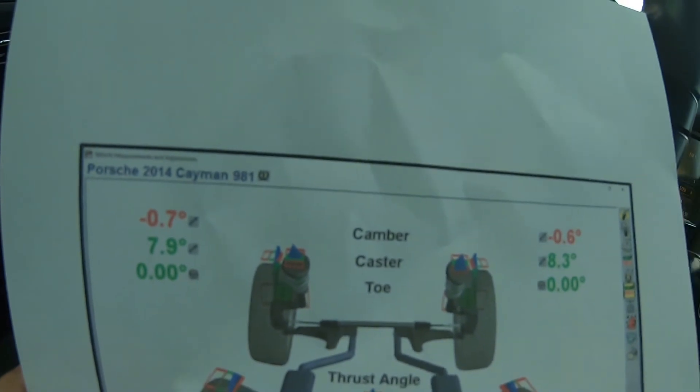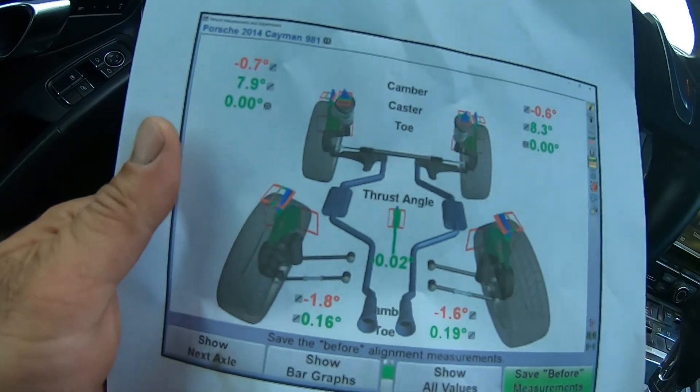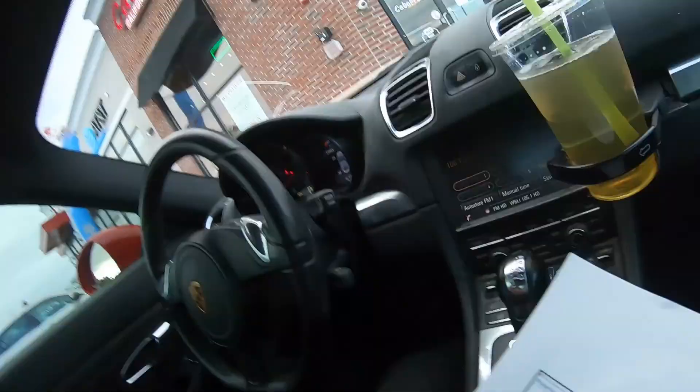I finished with the alignment. I gave it a little bit of extra camber in the front. Toe is good in the back and we also gave it a little bit of extra camber there. I stuck with toe on stock settings. I might take this car to a track because I've never felt this car on a track and want to get an idea for it. I gave it a slightly more aggressive alignment — not a full track setup, but something more in the intermediate. It won't make the tires wear too much more on the inside. Now I'm going to go on a test drive with this thing — maybe a little bit more of a spirited drive, just to feel her out.